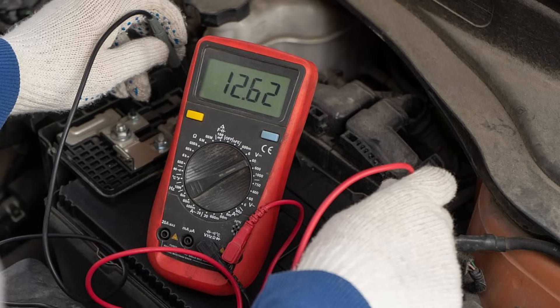If pulling the sensor, cleaning it, and putting it back in doesn't fix anything, you can actually test the throttle position sensor using a multimeter. You'll need to wire the multimeter into one of the sensors, then turn your vehicle on and have someone press the gas pedal as you read the voltage on the multimeter. As you accelerate, the voltage should go up. If it isn't, then you have an issue with the sensor itself. Testing this is a more advanced technique since you need to wire into the sensor, but it's not that difficult if you have the proper tools.